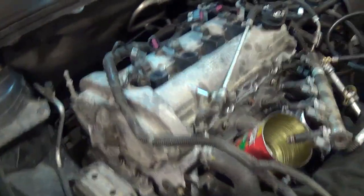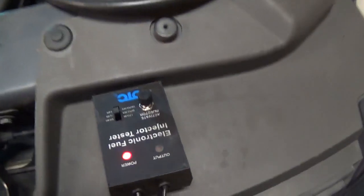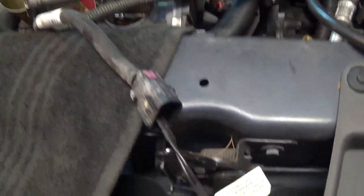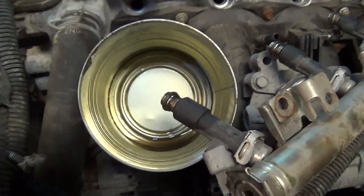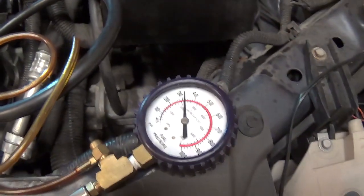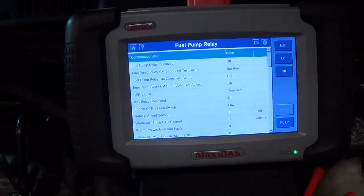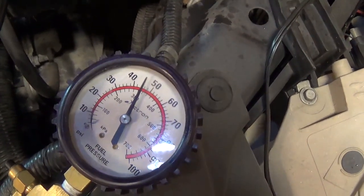Alright, we got the head back on, bolted down, everything's almost ready to go. Now I want to do the injector flow and balance test. Here's the fuel rail — we've got our OTC injector tester connected right to the main bulk connector. The lower pin is the main common feed and the four upper pins are injectors one through four. First we need to prime the fuel pump and pressurize the system to get an accurate reading. Through the scan tool I'm going to turn the fuel pump on. Our pressure stabilizes at about 45 psi.